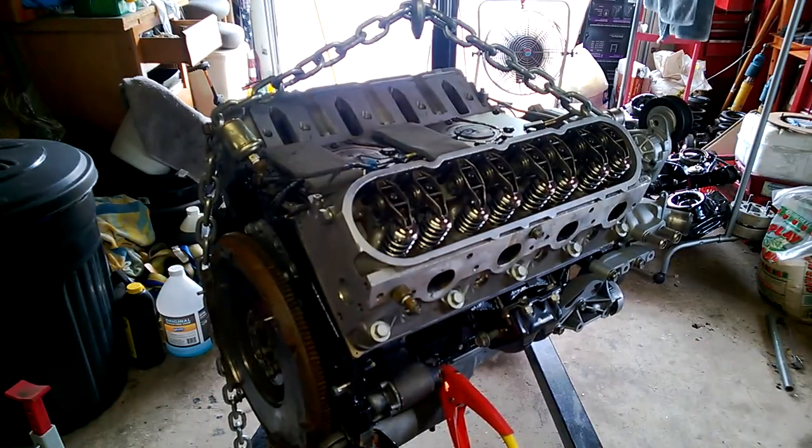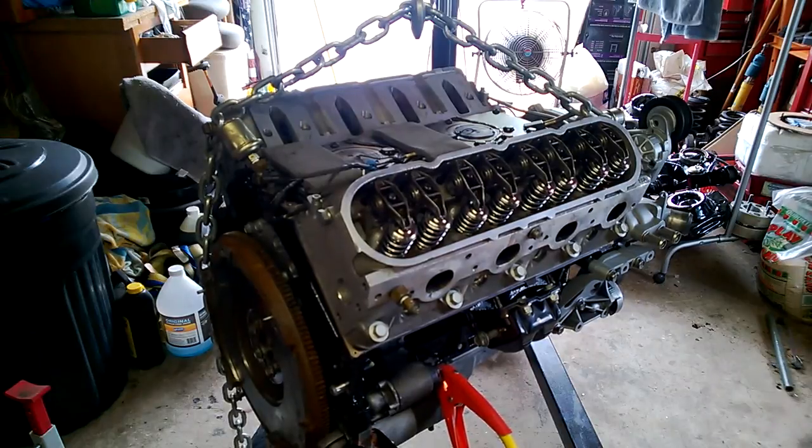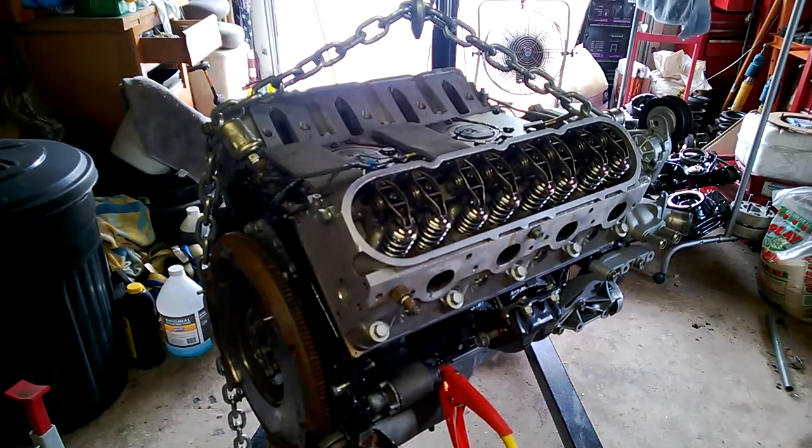It's not my ideal choice, but I'm only going to basically start the motor up, check for leaks, maybe run it for a few minutes, and then I'm going to shut it down and dump this oil out anyway, and then put a different oil in. Run it for 500 miles or a couple hours or whatever, and then I'll change it again. So it's not going to be in there that long.